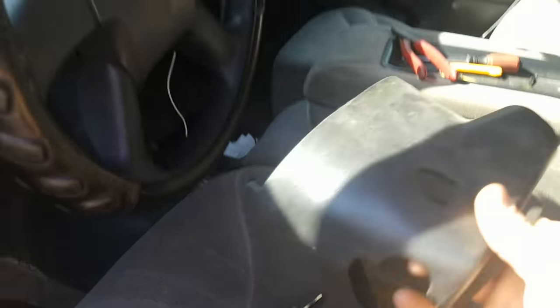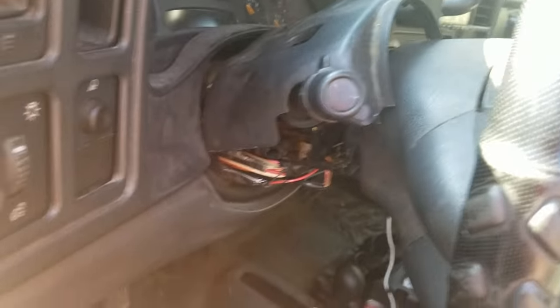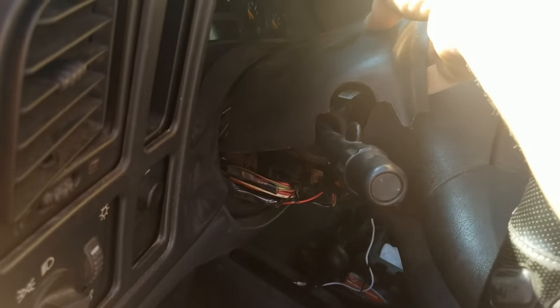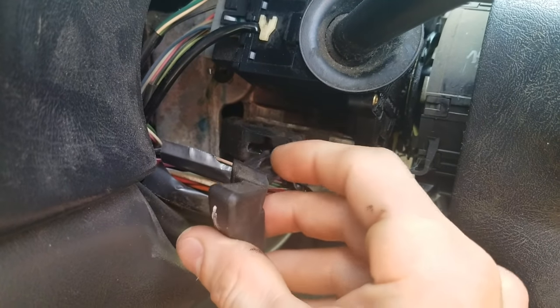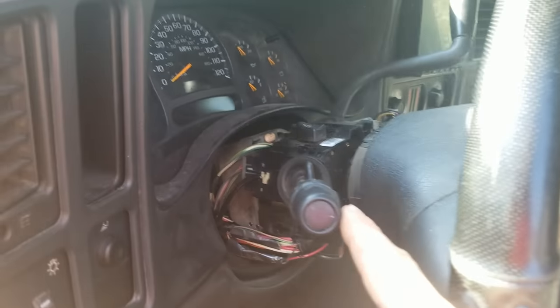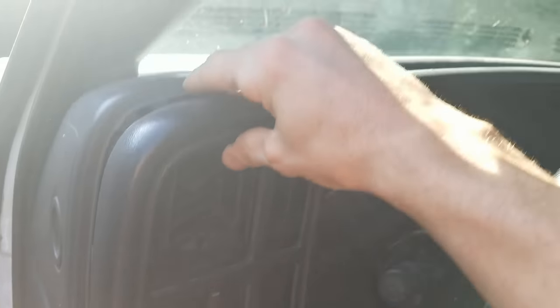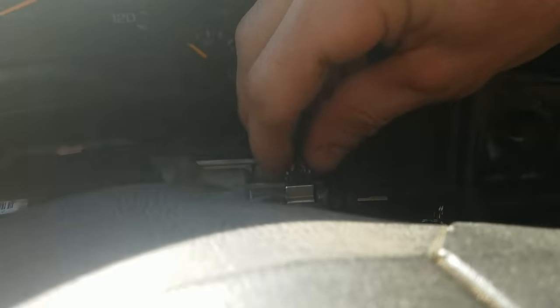Anyway, all you do — as you can see I've got these two covers off. This one goes on top and this one goes on the bottom. There are two screw holes on the bottom, like right here and here — they're Phillips screws. You take those screws out and then just pop the covers off. The steering wheel adjustment lever just pulls straight out but comes out kind of hard. The bottom panel has two 7mm bolts, and the side panel just pops straight out. Taking those two panels off makes it easier to get your covers off.